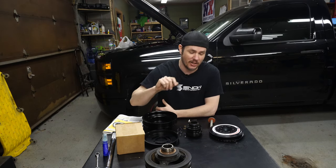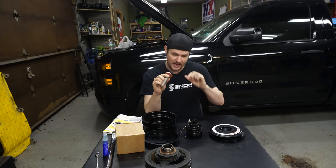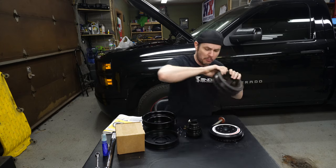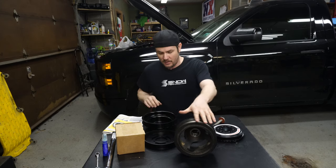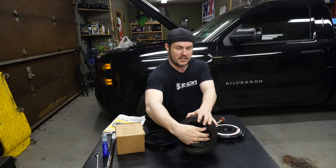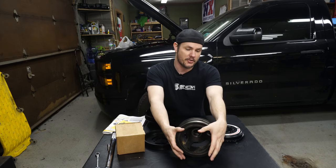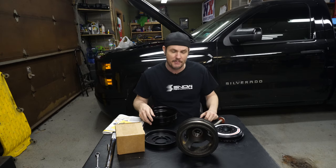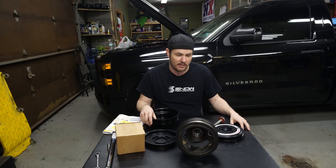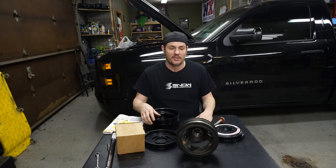If you don't have the pins that go into the crank, what you can do is take the one you removed and cut off the bolt head — the pulley will pull through it and it gives you something to butt up against. The alternative setup uses cam bolts that go around the outside where you twist them all down and it centers your eight-rib supercharger pulley. That's what comes with the stage two kit. But if you're going to be running something like an F1A or even a D1SC where you're worried about belt issues, go this route.